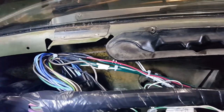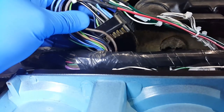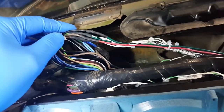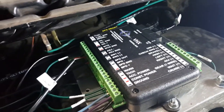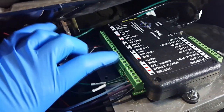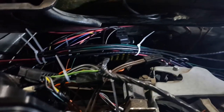For the wiring of the Dakota Digital dash, this is the main harness that feeds into the original PCB. All I did was cut a few wires to things like your signal lights, high beams, etc., and labeled everything to make it easier. Then run your wires across — I mounted the brain ECU to the top of my glove box. You just plug in your wires where the instructions tell you, screw it in, and you're done. The instructions are very very good.